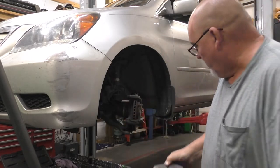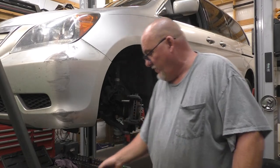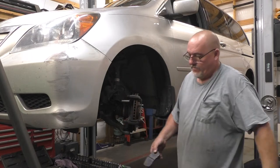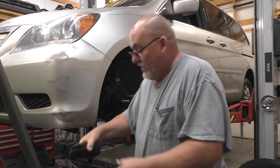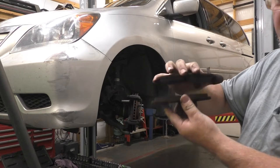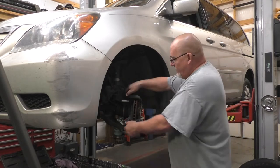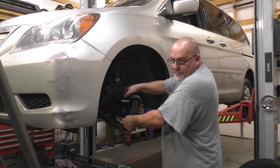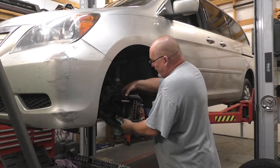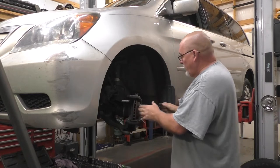There's really nothing wrong with these — the brake pads are still acceptable. Same with the inboard one. Starting off by looking at them — uneven wear on these brake pads means you've got a problem. These are never supposed to wear uneven. When the pins are hung up, when they're not properly lubricated, that can definitely cause uneven brake pad wear.